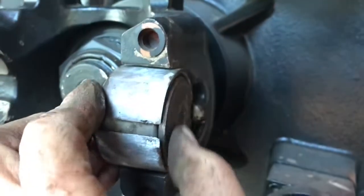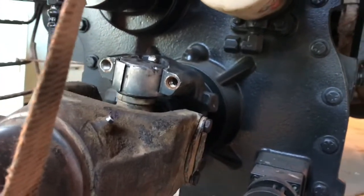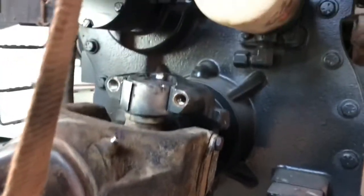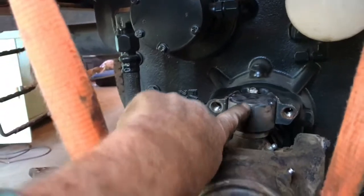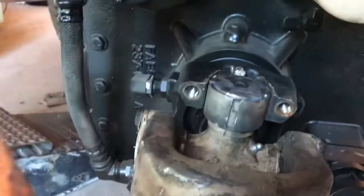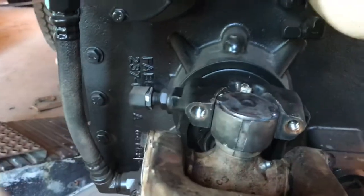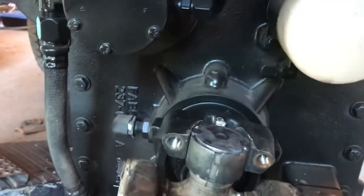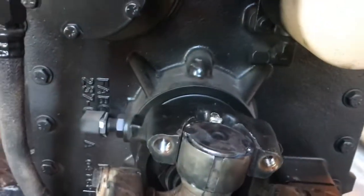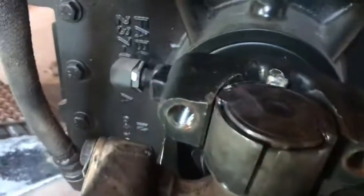This will fit in tight enough so it won't wobble back and forth — put a tack weld on both sides and see how it goes. I got my conversion u-joint adapter in. They don't make a u-joint to go from this size to this size in a heavy-duty truck application. To do it right I'd need to change the yoke, but at $170 each and three yokes, I'm not replacing a perfectly good yoke that's bigger and heavier than what I need.